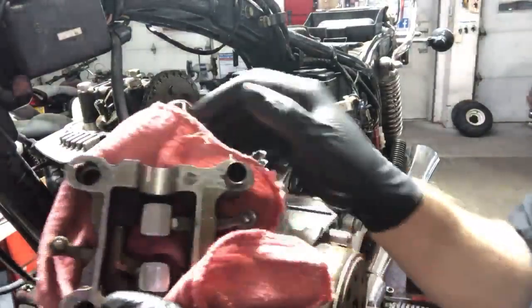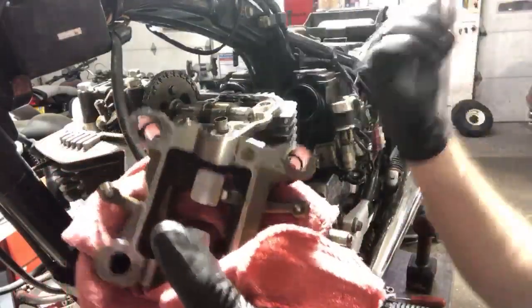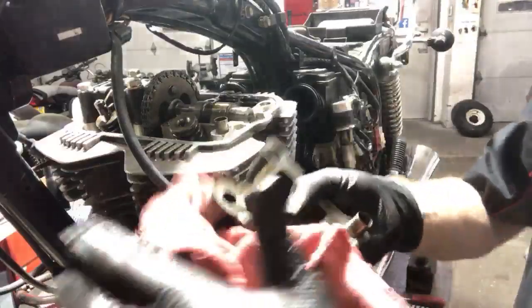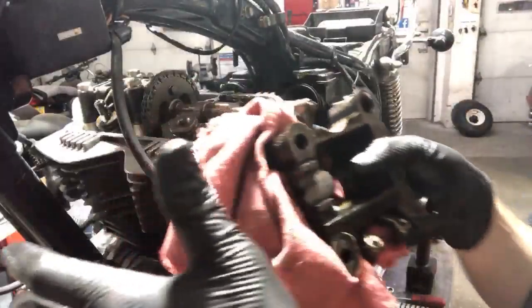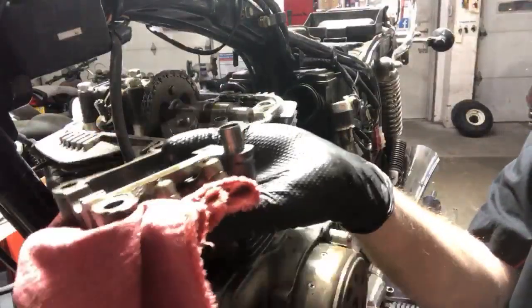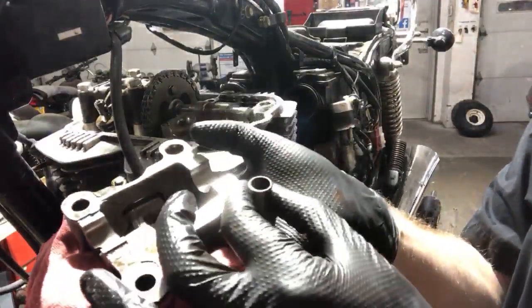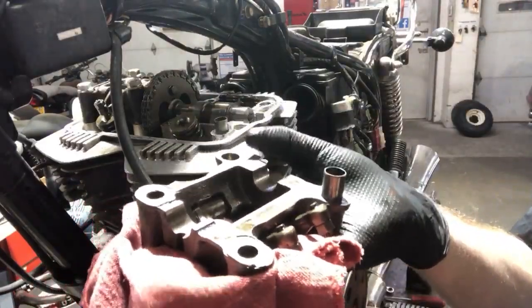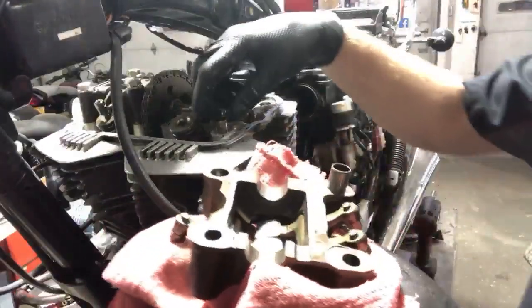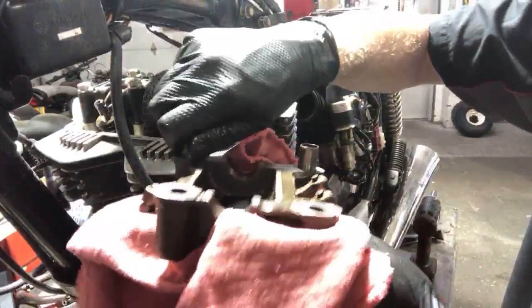So what I am paying attention to as well are these dowel pins. Okay, this kind of helps. What you got to realize is that your motor, as it's heating up and you're moving and throttling through it and powering up, is literally twisting. All this head and all this stuff is moving around on a very small level, shifting and torquing. And these dowel pins help keep this stuff all in line and set. It kind of minimizes that. On race motors, you'll see that these dowel pins are actually solid, to help with that inefficiency of a combustion motor. So I'm gonna pull both of these out, put them right back in here, not drop it. I'm gonna cover these up and lay them over where my stuff is.